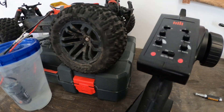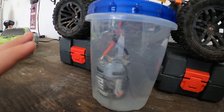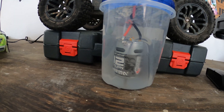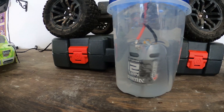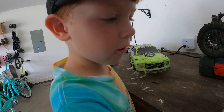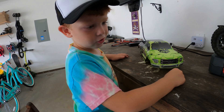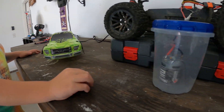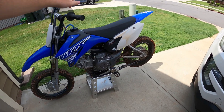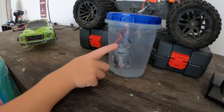It's been about ten minutes and we've got the trim set at about three-quarter throttle right now. We've got one twist around the leads but that's not a big deal. The water is graying up — a lot of particles are getting flushed out of that motor, which is going to make those brushes seat really well and make the motor a lot more efficient. While we're waiting, we've got the TTR 110 out and we're going to get that washed up as well — this thing is absolutely filthy, we haven't washed it in probably two weeks.